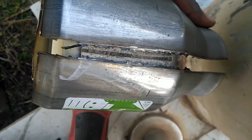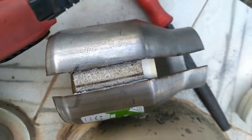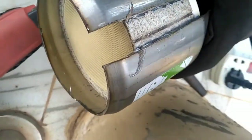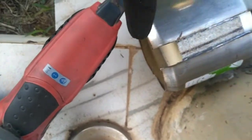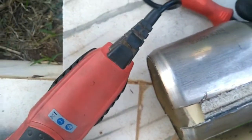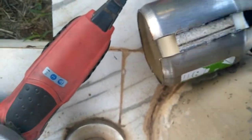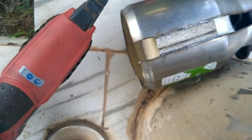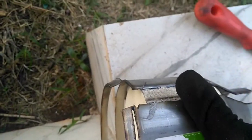At this point I'll pry the casing apart and push the substrate out. Make sure to be wearing gloves so you don't cut your fingers. If the casing doesn't want to come out, you may need to have made your cut further along. If the casing refuses to come out, move the substrate backwards and use your grinder to take off some more material so it falls out when you tilt the casing.